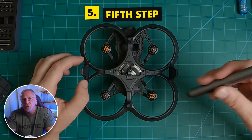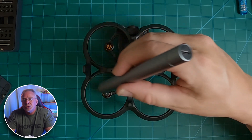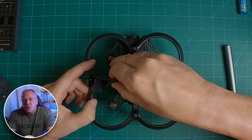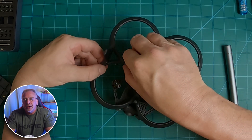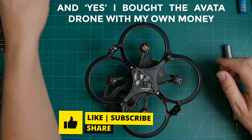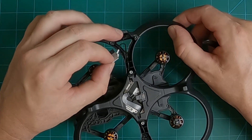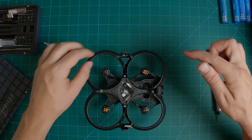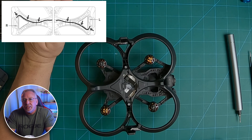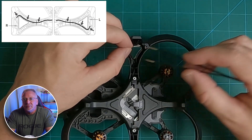Step five: take off the two screws on each side holding on the landing gear, which also hides the antennas — four screws total here. Once you've removed the screws, pull the covers in toward the body of the quad and pull up to remove them. Then pull the little tab on each antenna to remove the antenna board itself, and pull all the antenna cable out of your way. You'll find the cables recessed in the grooves of the ducts — note how they're actually in there so you can reinstall the cabling the same way when you put everything back together.